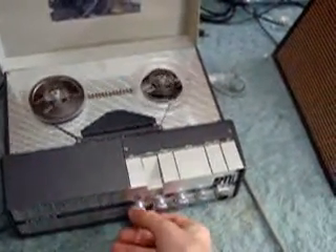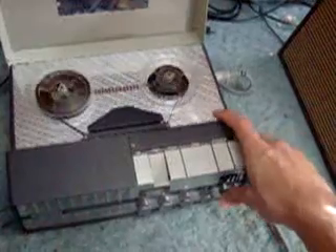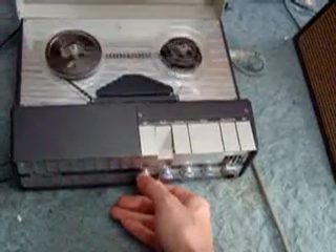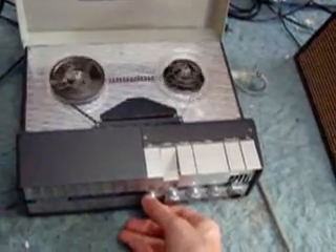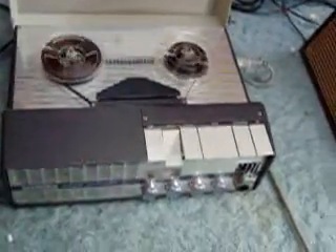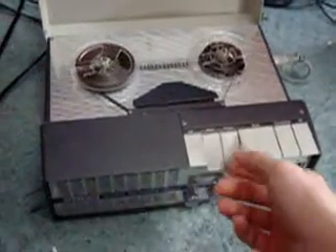The tape wasn't recorded on this machine; it was recorded on some other portable machine. But as you can hear it's too fast right there. This is supposed to be at approximately three and three quarters — well it's not. The speed is set to three and three quarters, but it's actually at the one and seven eighths position. Now it's set to one and seven eighths but playing at approximately three and three quarters. I can hear the motor again — hear how fast it's going. It's supposed to be going a lot slower than that.